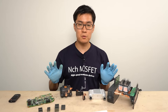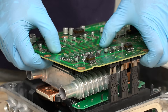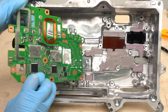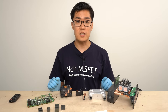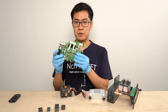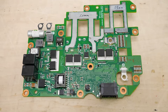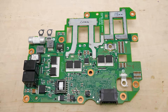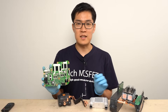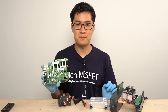I disassembled the power control unit of the 5th generation Prius. From what I saw inside, about 50% of the components have changed compared to the 4th generation. By optimizing and redesigning the overall structure and internal circuits, quite a bit of extra space was created — there's still enough room that I can fit my fist in. Especially the 12V output DC-DC converter made by Toyota Industries, the last part I disassembled — I can honestly say it's completely different now. Optimization with new circuit designs and structural changes must have been extremely challenging. My honest impression is that I can't believe they managed to take it this far. I'm really impressed. Thank you for watching.